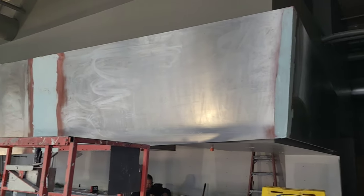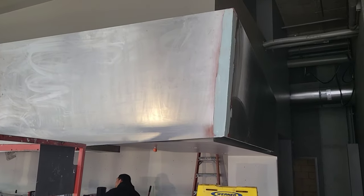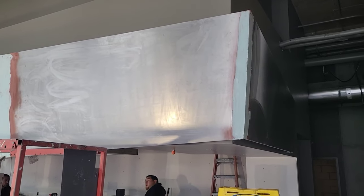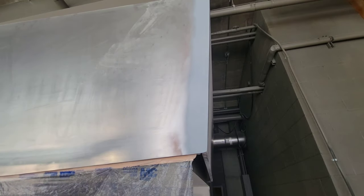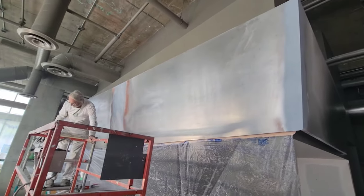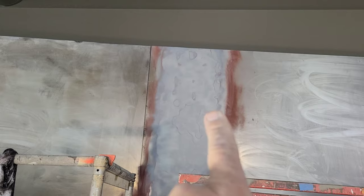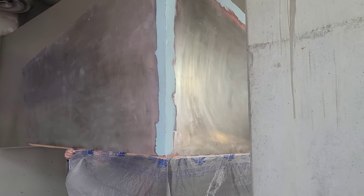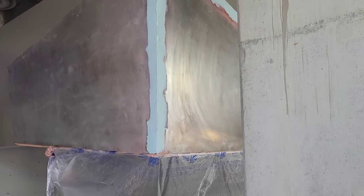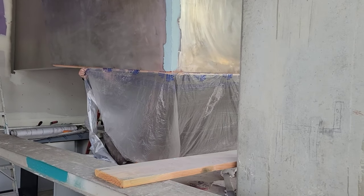Alright, so we've got that filler on there. Might as well use these for sanding — it's probably the best for that. So we've got this corner — that's what it looks like before paint, so that should turn out pretty good. High-end body filler on that. So that's a guide coat — just a thin coat of primer that we're going to sand off, and you can see wherever there's a low spot there'll be gray there. This seam right here is already going to have to be sanded down. We've got a guide masking down here — that's no-flake paper.